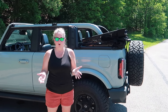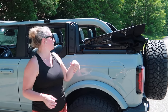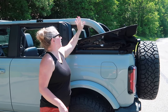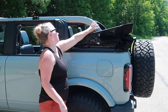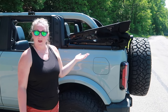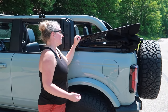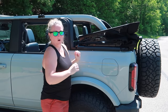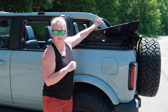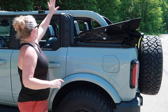A lot of the struggle happens when putting the top back on — many people have scratched the roll bar. I know some people put a clear film or a rubber protector on it, but I've had this since last September and put the top up and down multiple times without scratching it. The biggest thing is paying attention when pushing it up that you're not pushing into the car. If you feel it leaning a certain way, brace it so it doesn't have the chance to rub.